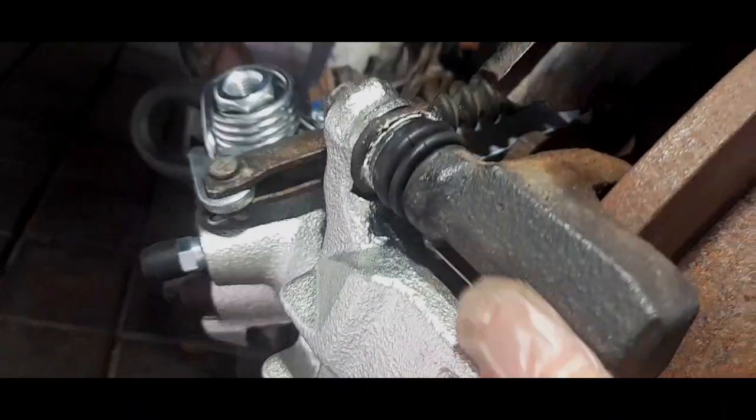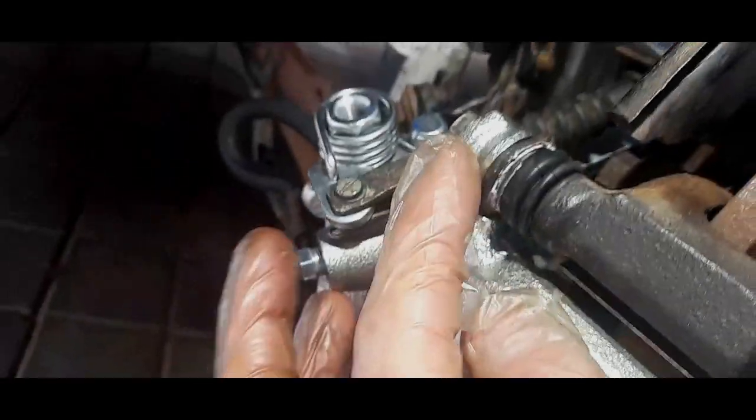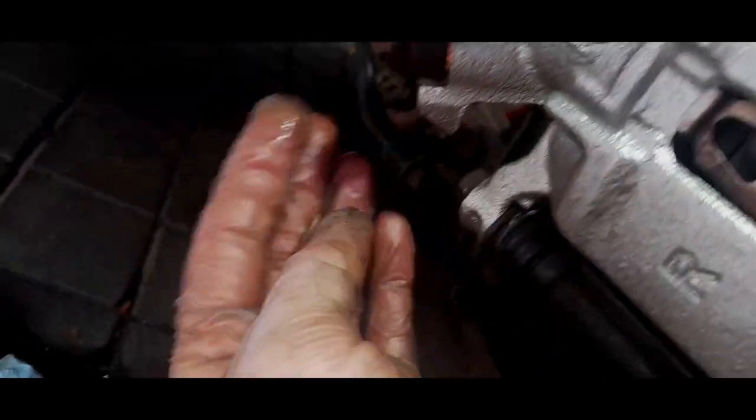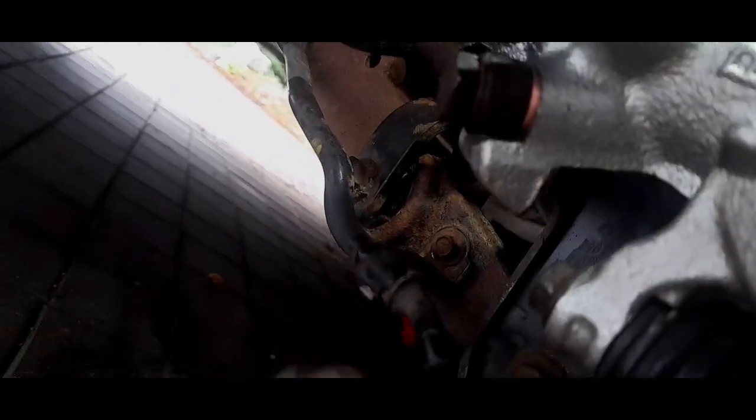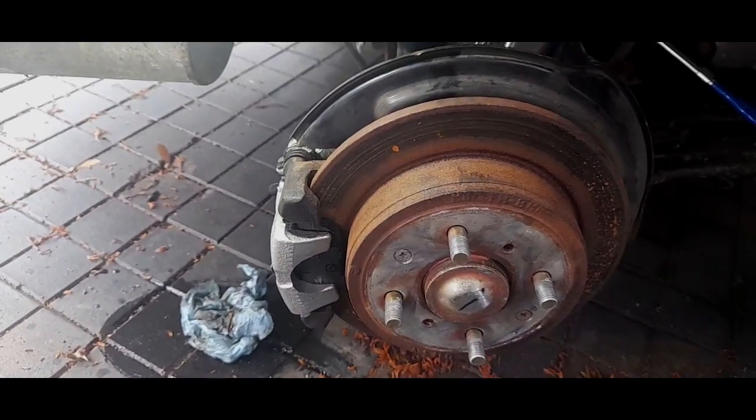It's all sitting nicely and the sliders are in there and bolted up. You can see some of the excess grease but it's all good - all bolted up and it's not leaking at all. I'll just go over with some brake cleaner. I'll nip that up now because I couldn't do it while the caliper was loose - and that is that for this side. We'll just repeat on the other side.